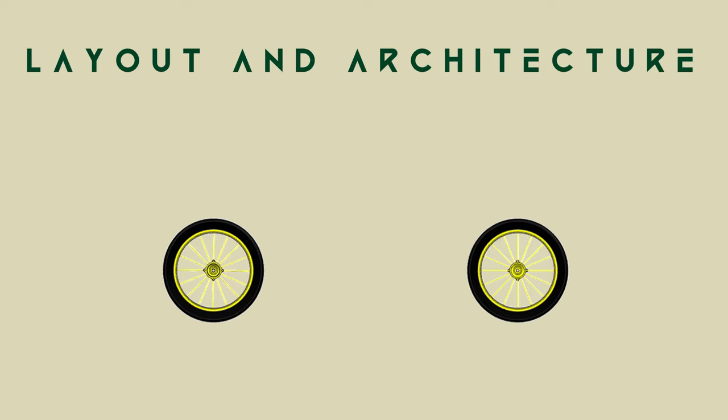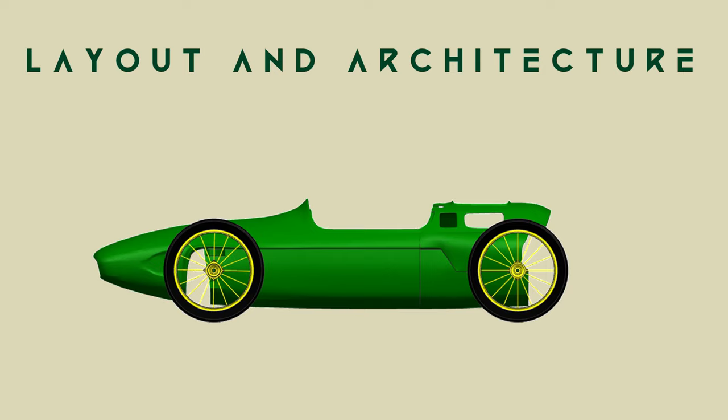Let's start to lay the car out. For a vehicle like this, where aesthetics drive the design, we start with getting the scale proportions of the tribute vehicle looking good. We start by putting the wheels to their maximum position as per the guidelines — 40-inch track, 66-inch wheelbase. As the bodywork basis, we found the Lotus 25 3D model off the internet used in one of the computer racing games. We then played with the scale of the body to fit the new wheelbase and track width. For the Lotus, the guideline wheelbase was just slightly too short, so we went out about an inch to 1700mm on the wheelbase, which kept the proportions of the base car.